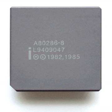The 80286 also added new instructions for protected mode: ARPL, CLTS, LAR, LGDT, LIDT, LLDT, LMSW, LSL, LTR, SGDT, SIDT, SLDT, SMSW, STR, VERR, and VERW. Some of these instructions for protected mode can be used in real mode to set up and switch to protected mode, and a few such as SMSW and LMSW are useful for real mode itself.